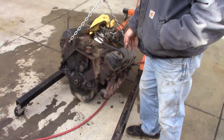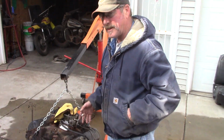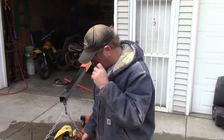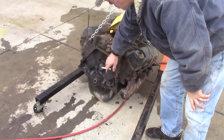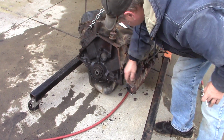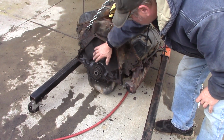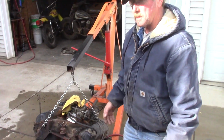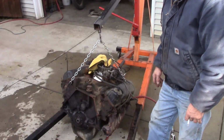When we took the bell housing off, I wasn't used to Ford. They got that mid plate in between. And I thought I could just take the starter off, but you gotta disconnect the starter because it's going through a mid plate. But under that mid plate was a whole mouse nest in here. But something here, you know, the gasket or something was flinging oil around. This is all full of oil. That could have gotten on the clutch. But he said it slipped from day one. Yeah, too weak of a pressure plate was in it.